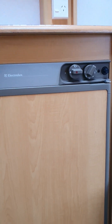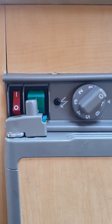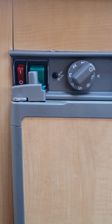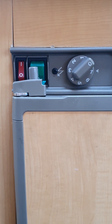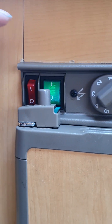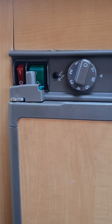Just opposite your room heater is your fridge. Up on the top left, the wee red switch is to run your fridge off battery — it's not currently wired up. You can get an auto electrician to wire up a 12-pin trailer plug, and then the night before you go away you'd cool your fridge down on mains power or gas. Once you hook up your caravan you can turn the 12-volt on and it'll just maintain the temperature — it won't cool the fridge down from warm, it only maintains. Just next to that is the green switch for mains power — as long as mains is plugged in your fridge will start to cool down, and there's a wee temperature dial from one right around to seven. Flick it off to turn the fridge off.